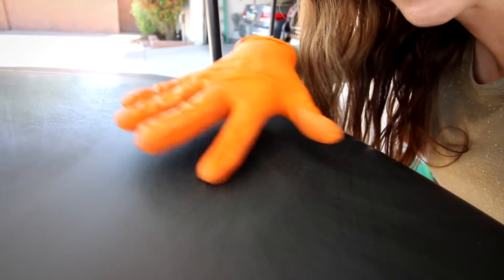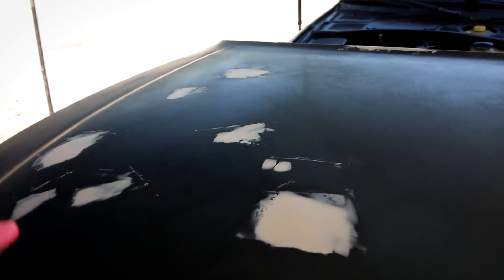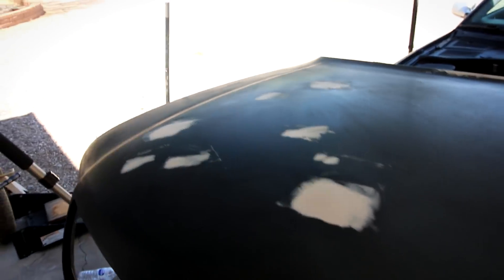Just sanded across it again. I can feel a little bit of a low spot right here in the front of it, but the high spot has been knocked down. I think it's good to go - I think I definitely knocked it out. Somebody cue the Bondo making music. Hopefully I only have to do one or two passes with filler and I should be done.